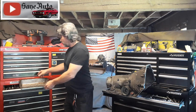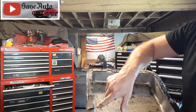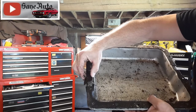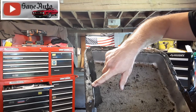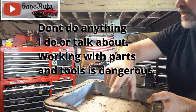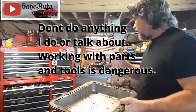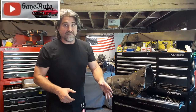Well, it could be that you over-tightened the pan gasket. If you look at this old pan gasket here, it's kind of flat and it's split — you can't really see the split until you move it. Over-tightening these on these earlier pans also makes a bump right here, and I'm going to show you later how to fix that bump. But if you've put two or three gaskets on here, making sure you're not over-tightening, and you still have a leak — well, it's probably because it didn't have a pan leak in the first place.